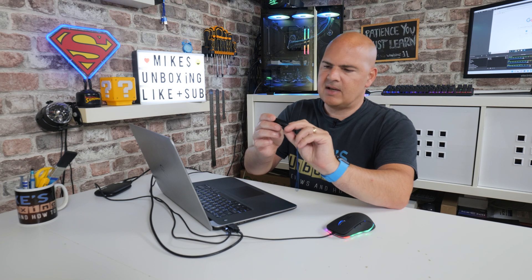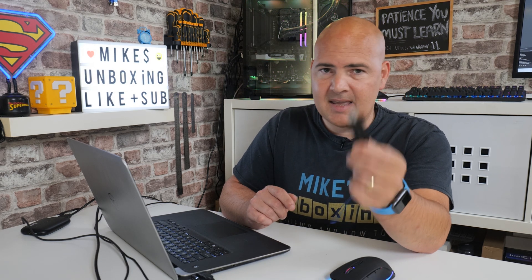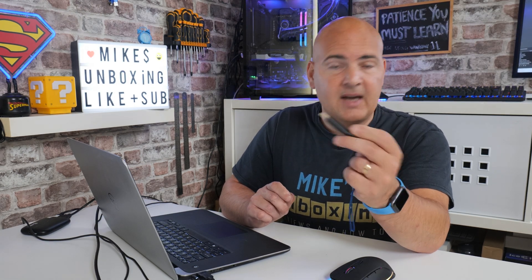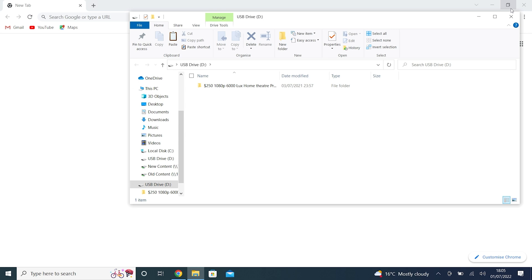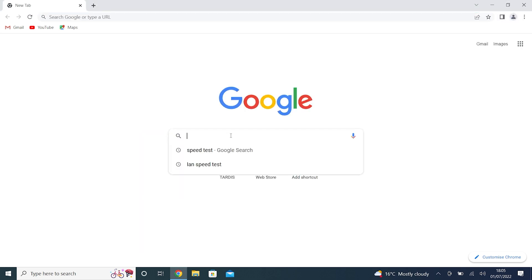The first thing we're going to need is a USB drive. I've got one here — this one is a 32 gig SanDisk Ultra USB 3.0. I would suggest USB 3.0 if you can, because it's going to take less time to write data and to install Windows. You can use an 8 gig drive with USB 2.0 if you want to — 8 gigs is the minimum, there's no maximum. There is some stuff on there but that will be erased as we go through the process.